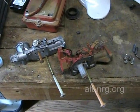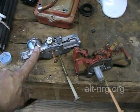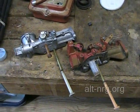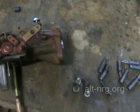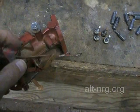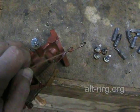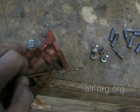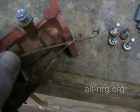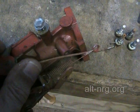Examining the two carburetors — this is the original and this is the retrofit, which is actually an older vintage carburetor. You can see some striking similarities and some definite differences. This carburetor is designed to operate the engine at a fixed speed, so it has this little piece of linkage that connects to a regulator actuated by air current generated by the cooling fan of the engine. It pulls against that spring and keeps the engine running at a constant speed.